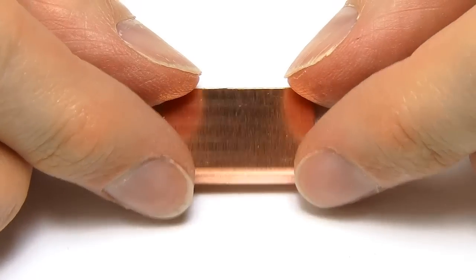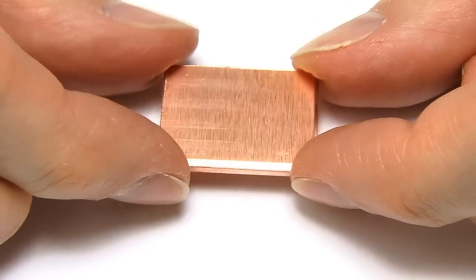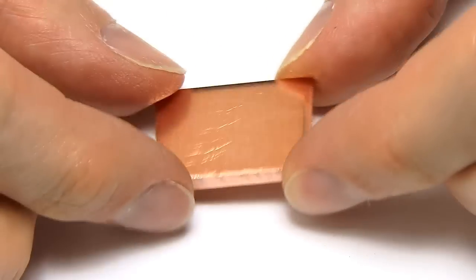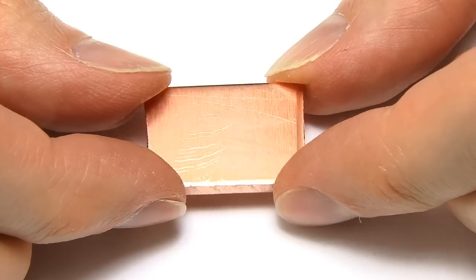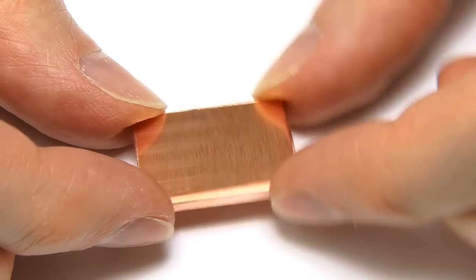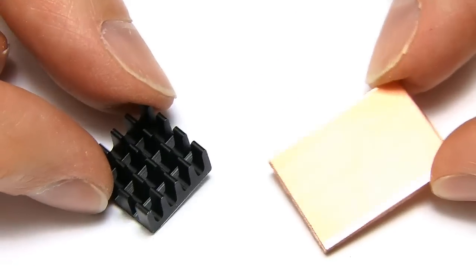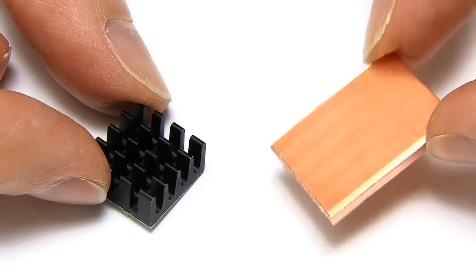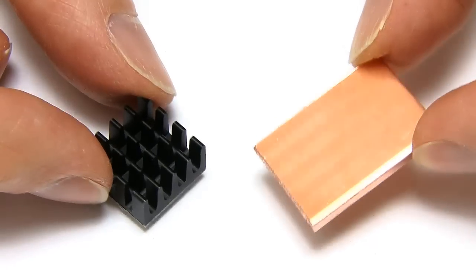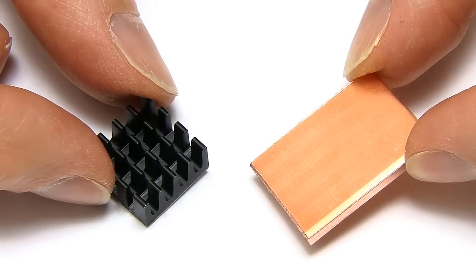Here's our final piece of very shiny copper, which I've cleaned up with a file a little bit on the edges and also cleaned both flat surfaces with alcohol, so it's going to have really good adhesion to our thermal compound. I found it fascinating to compare this to the other Raspberry Pi heatsink — yes I've cut this one a bit bigger, but it is probably five times the weight of that one, so massive metal is going on top of our Pi 3's processor.